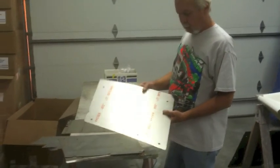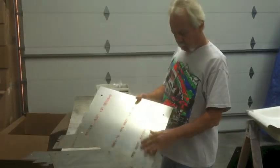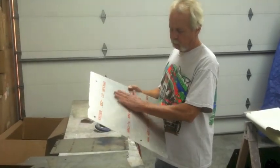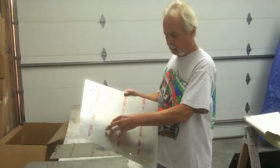It's a step process. First we'll take lacquer thinner, wipe them all down, get all the printing off, and then we use an acid wash to smooth it out. The acid wash will pull up the loose metals in there.